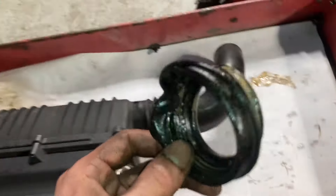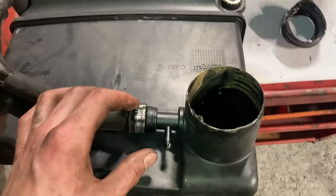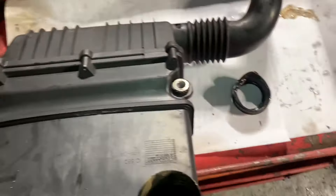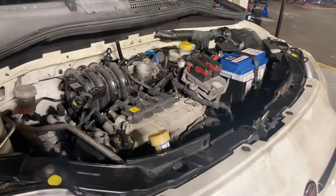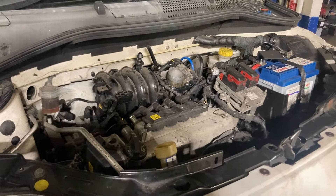We're going to replace the seal here, get some new hose put in, and clean out the air box as well — brake cleaner and an airline through there should do a good job. Everything's done now — just turn the key and it worked.